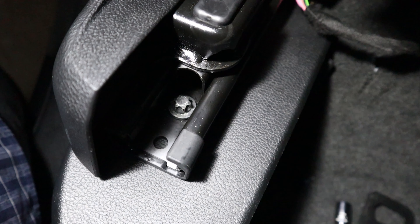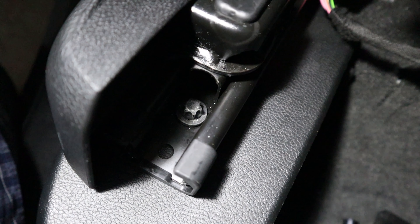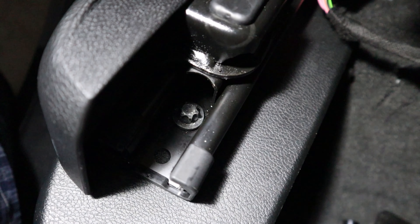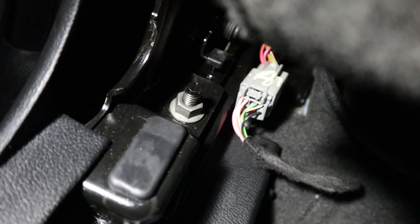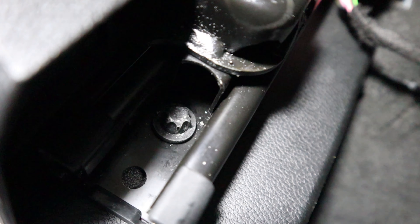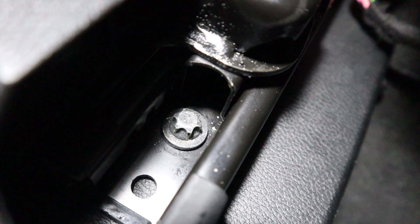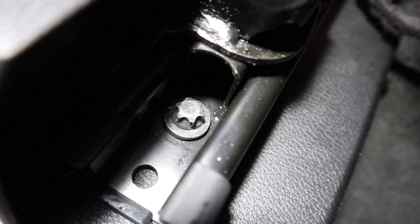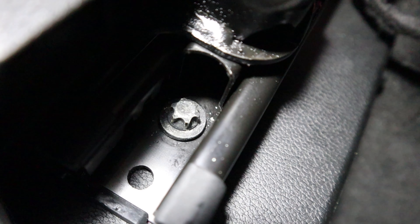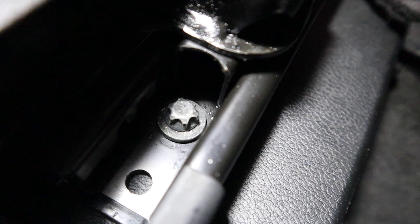There's a small issue — the instruction manual doesn't have any pictures, and it says to take out the outermost forward bolts with the 10mm socket. There's one bolt there which looks like it could be easily replaced, but it's actually a security bolt. I took it out already and it took a lot of force — it was torqued heavily from the factory, and it took me about 25 minutes to loosen it up. I put it back in so you guys could see. It is in there good because it's not supposed to be removed, but we're going to remove it.